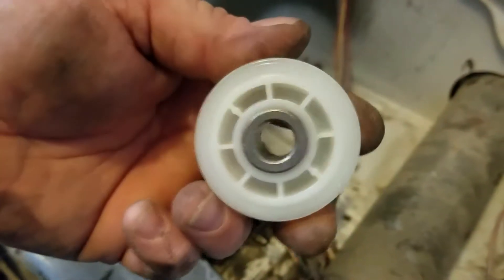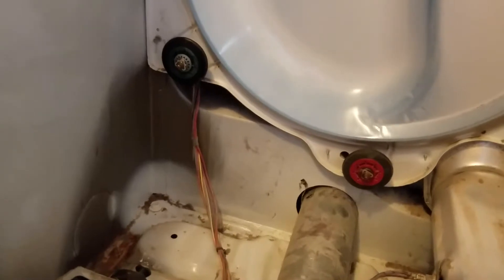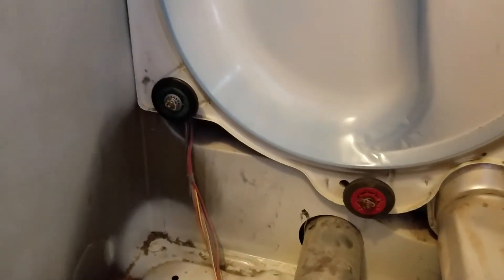I've got three more of those to go, but before I do that I'm going to put this idler pulley on this shaft right here. That little washer's sole job is to keep the metal from this pulley from touching the inside. That sounds way better! Let me snap a triangle clip on that. So that's the idler pulley — that spring puts the tension on the belt. And here's your drive motor right here. Now I'm just going to replace the rest of those drum rollers and put it back together.